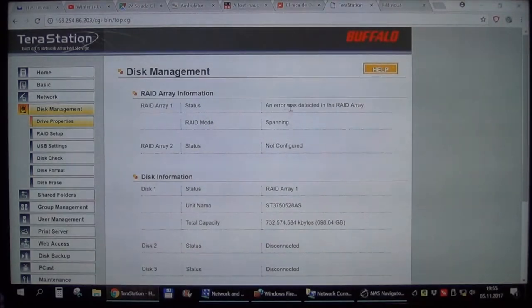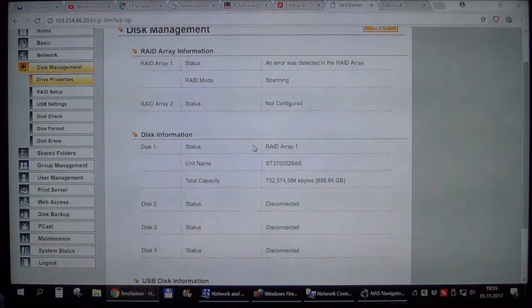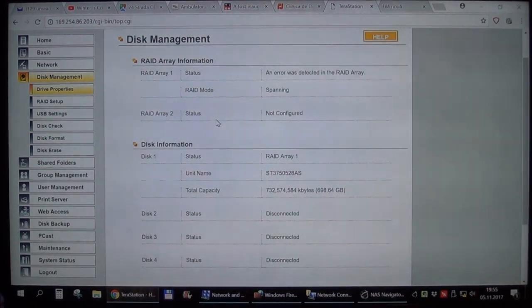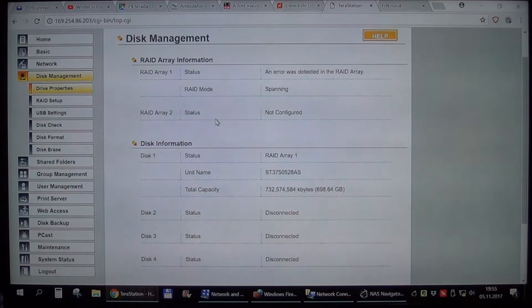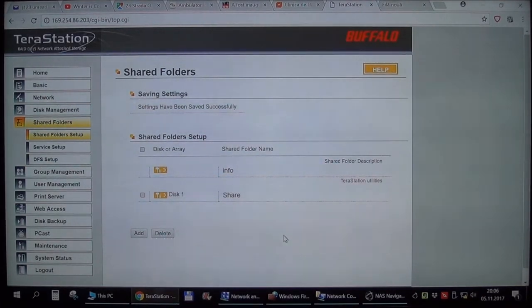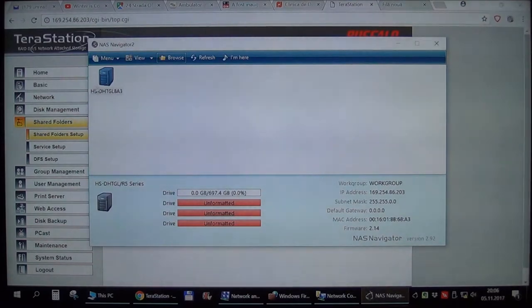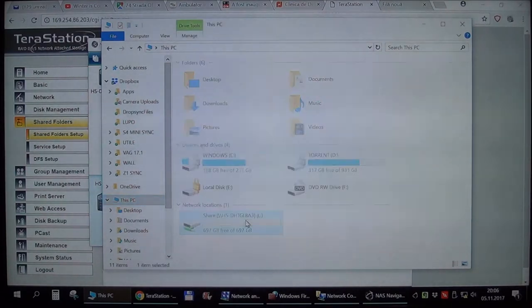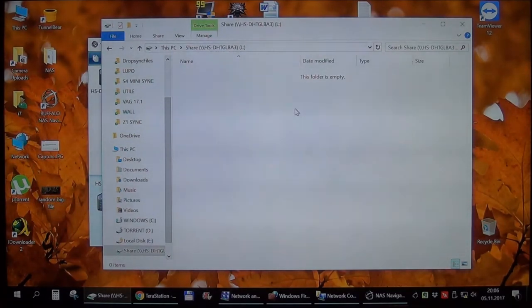Here in RAID mode I am going to configure each drive as completely independent, so each drive will be 100% independent from the others. You can remove a drive and only lose the data on that single drive, not everything. I'll do that off camera since everybody sets up their RAID the way they want. Okay, everything is done. To access the share you need to create a folder — in my case with only one disk it must be named "share". Then you go to NAS Navigator and click on Map Share; it maps it to a free drive letter, in my case L.